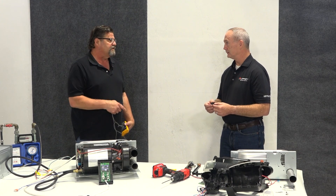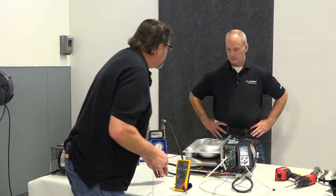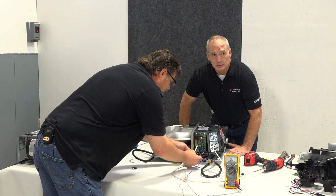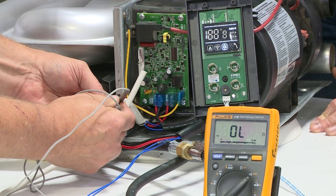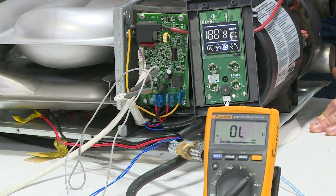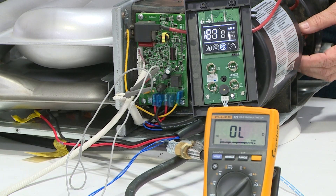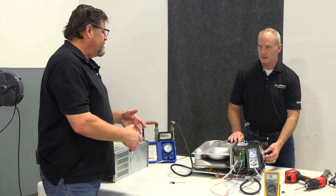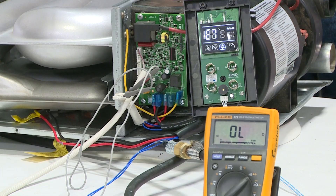Imagine if you go to a light switch in your home and turn it off and on every ten minutes. There is another way of doing this too, if you have it unplugged and on the bench — between the brown wire and the white wire. That plug came off the main board. As you can see, we have no continuity. But if I take this switch and go boop, you get continuity. And that tells you both the sail switch is good, the ECO is good, and the wiring is good — because you just went through the entire circuit. That's right.